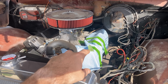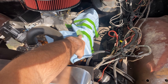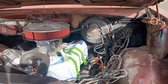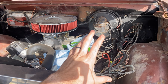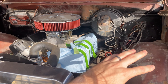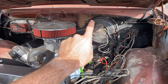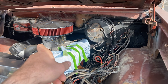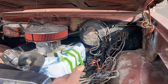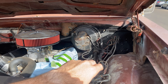The power plant — ignoring my little rag cover here — this is because the valve covers just do not fit with this small block vacuum booster and master cylinder setup. You can swap them out for a hydro boost setup, but the big block systems are nowhere to be found. You cannot buy them anymore. You either have to go to a junkyard and find a big block truck from the '70s — 72 to 78 when they stopped making the big blocks — and rebuild it to swap it in, or you go hydro boost, or you kind of massage this a little bit.